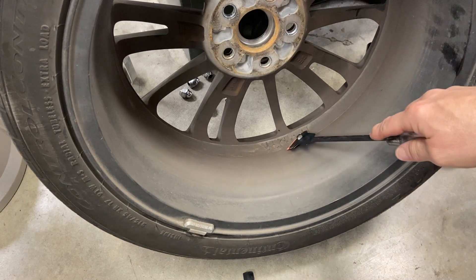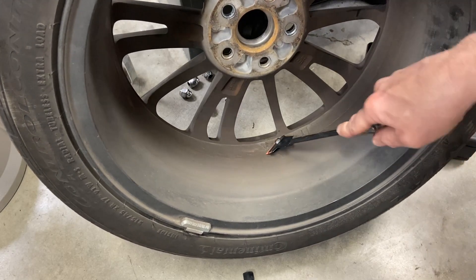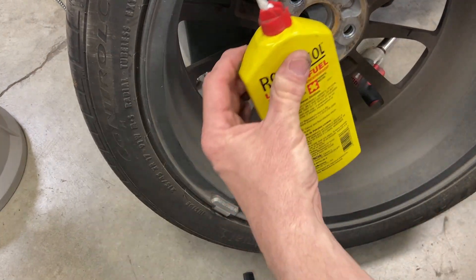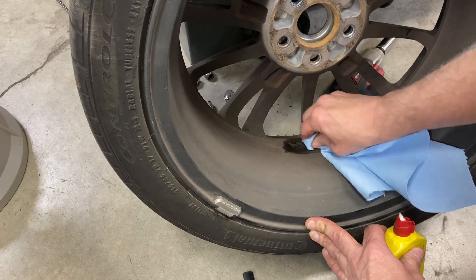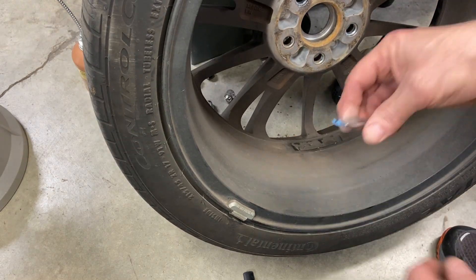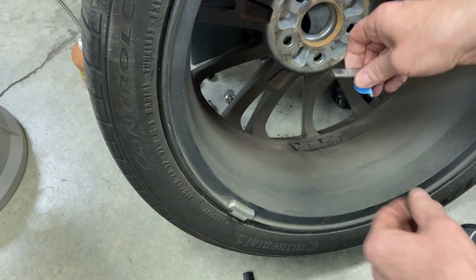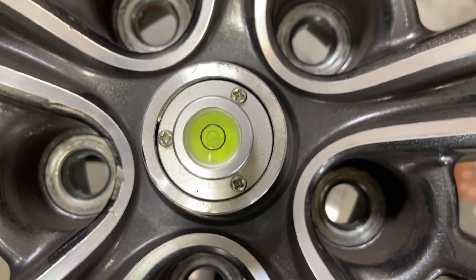To not damage the wheel — many are alloy or aluminum so they're very soft — I'm using a plastic scraper to get most of the adhesive off. To get the rest of it off I'm going to use a little bit of lighter fluid, which dissolves that adhesive pretty well and provides a nice clean surface for the new weights. Now that it's cleaned off, we determined we need about one ounce of weight, which will be the combination of these two. We'll pull the backing layer off, exposing the adhesive, and apply it down here. With the weight on, let's check the balancer one more time — it looks pretty dead on.